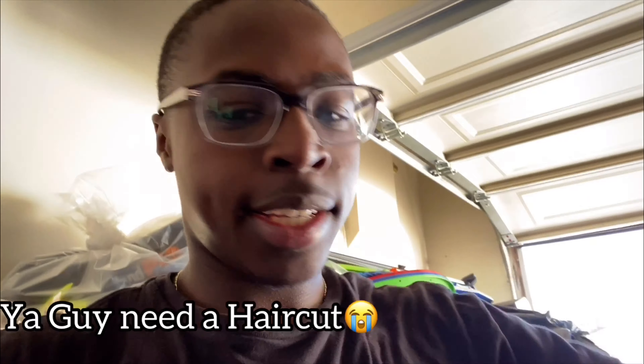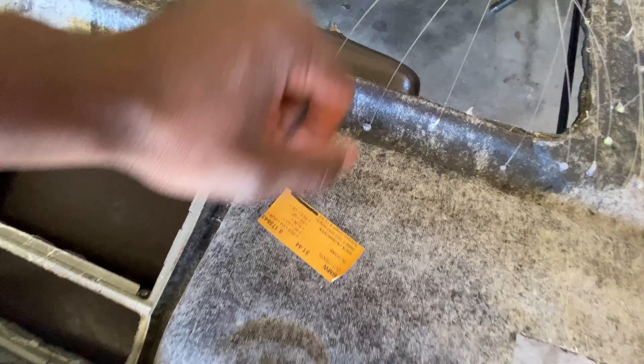About to finish up the last touches on the headliner. I ordered a 550-strand kit — I saw someone do it with a 500 kit on a Charger and figured 550 would be great. But having a sunroof actually gives me less space, and it's a coupe rather than a sedan. We're going to make it look like a real Rolls-Royce all the way from front to back. The process is: poke a hole, feed the strand through, and hot glue it on the back side — easy.